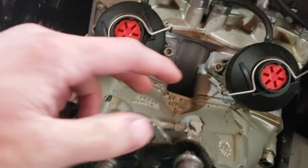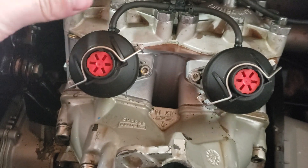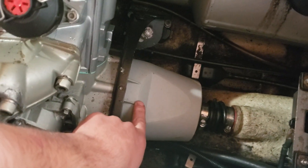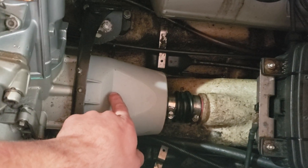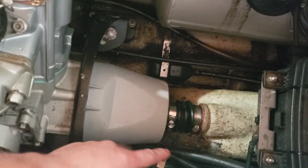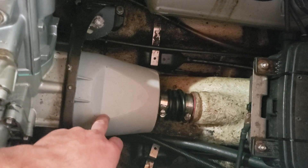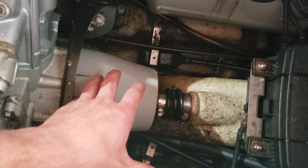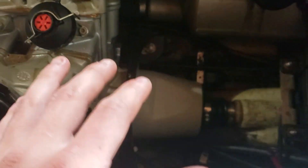After you've done that, you're probably going to want to pull your exhaust bridge to the port here where it goes from a 2 to 1 — that'll make it a lot easier to pull out. After that, you're left with the decision of whether you want to disconnect the wheel under here, or whether you want to try and pop it out of the PTO. It may seem like it's press fit, but it's not — it's just a spline that runs to the jet pump. There's a fitting on there, and if you pop it all off, it kind of releases like a vacuum pressure. The way I did it was when it was disconnected — just gave it a couple of love taps with a dead blow, and it slid right out.